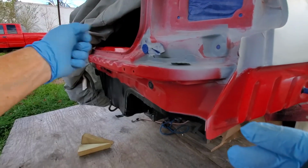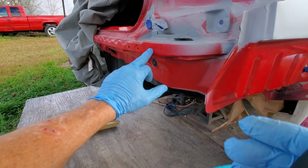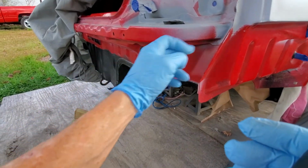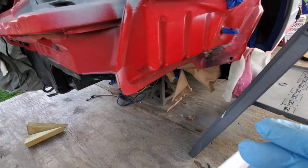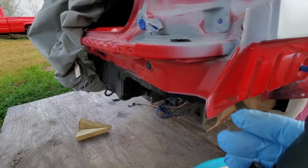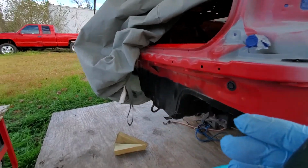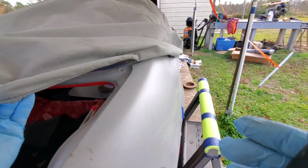When you respray over this, you're not gonna see any difference between the red that's out here, the R81, or the primer. If there is a shade difference down in here, it's behind the bumper anyhow. It doesn't matter, but it shouldn't ghost at all. There's no transparency in the paint that I'm using. R81 is a solid. There's no metallic base and nothing like that, so it won't show through.